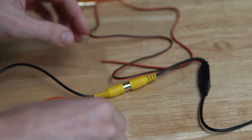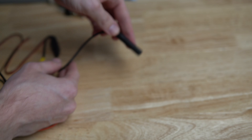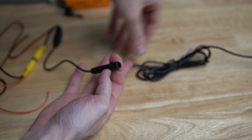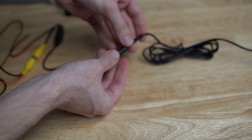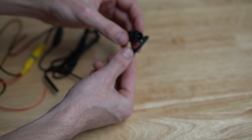I've just sussed out the wiring, so I'll take you through it. For this specific reverse camera — and I'm guessing it's probably going to be the same for most reverse cameras — there are three wiring bits you get with it. The first one is a long cable; one end has your RCA connector that goes into the back of the head unit, and it has a red wire that comes off it — that's your 12-volt reverse signal.